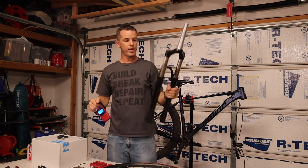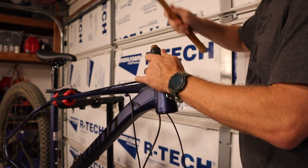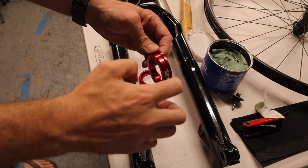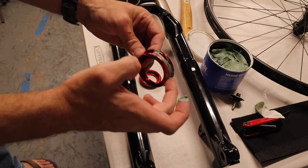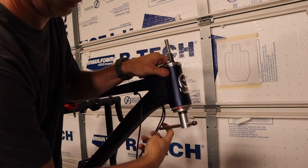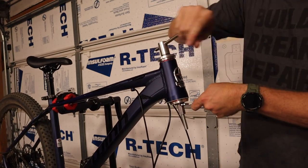The RockShox come in at 4.7 pounds, so we're already shaving a ton of weight off here. Next is to remove the bearing cups — you can do this with a hammer and a screwdriver; they do have specific tools, but I've always just used that and it's worked fine. We're going to prepare our new headset for installation. I always like to cover it with a little bit of grease to prevent things from seizing together if you ever have to remove it again. Now, installing the new cups requires a cup press — a lot of people try to smack these in with hammers and it almost never works and usually does more damage than good. I'll have a link to the one I'm using in the description.